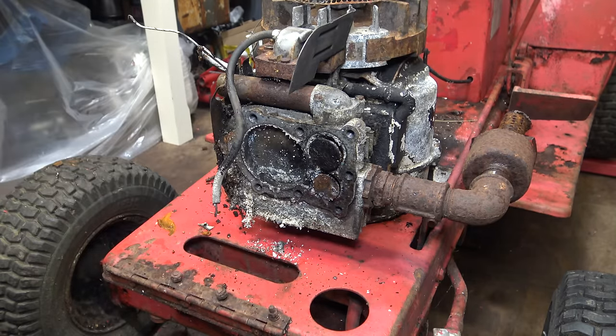Well, that's as clean as I can get it without using any kind of rust treatment, so I do have just a very small amount of rust converter, which I'm very carefully going to apply. But what I don't want to do is damage the aluminium. So if it can just eat away at that top layer, I can then wash it off, and hopefully no damage will be done to anything else. The same will have to be done in there. So I'll just give that 10 minutes.